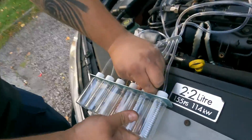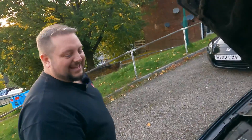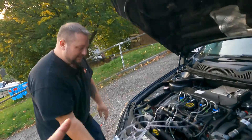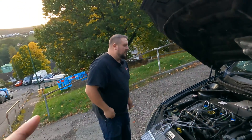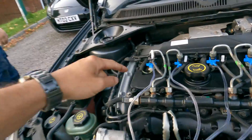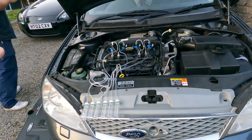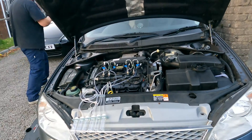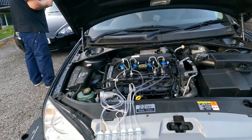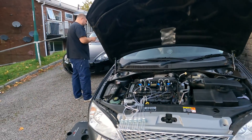I failed science, so at least hopefully we can do this today. This is the most science we've ever done! So the first part of the procedure is idling for two minutes. You literally start and you'll see the diesel come down the leak-off, get the stopwatch going, and then it's alternating between 30 seconds at 3,800 RPM and then 30 seconds at idle. They call it the five minute test because it takes five minutes all in.